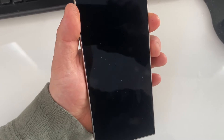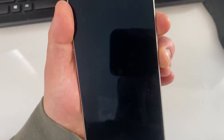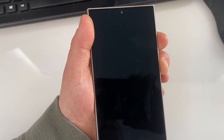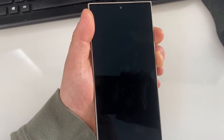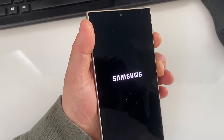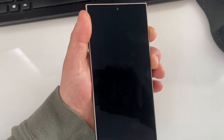Once the phone is off, you'll need to press volume up and the power key. Keep holding volume up and power. If it doesn't turn on, release and press again until it comes up. And it's going to get you to recovery mode right now.